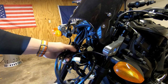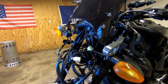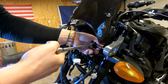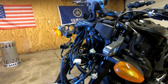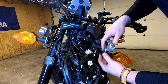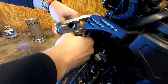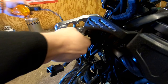With the headlight housing removed, I'm going to take my cowl off. You guys probably won't have to deal with this, but if you're interested in this cowl, it's a nice cheap $20 cowl I got off eBay — I've done a video on it, check it out if you think it's cool. Let's pop that off and move on to the turn signals, which are pretty easy. You just peel up the rubber portion, slide the plastic out and they kind of squeeze through. Super simple. Definitely not going to miss these.